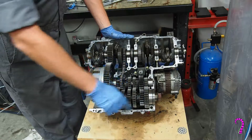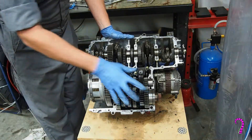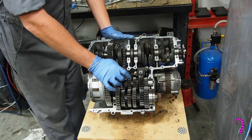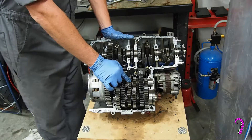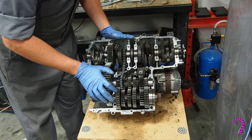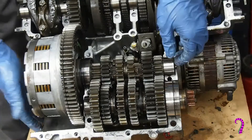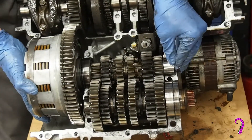Here's the transmission. We more or less want to stay away from here — we're going to have to remove it, but we want to be careful not to disturb the order of any of the gears. Very few problems are caused by worn dog gears; it's very distinctive. Here's the clutch basket. We should be able to just lift the main shaft and the counter shaft directly out of the bike.